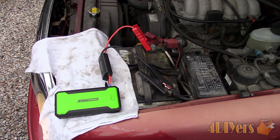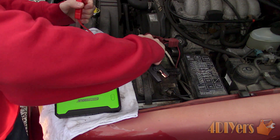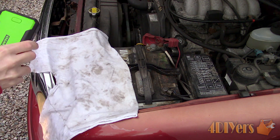If the battery was low, it's important to build up the charge by driving the vehicle for a certain period of time. This will depend on your battery's capacity and vehicle. This can be anywhere from 30 minutes to one hour of driving. It's best to drive the vehicle at a higher RPM so the alternator will have a higher charging output.